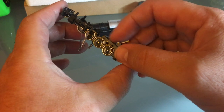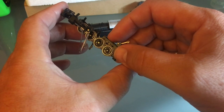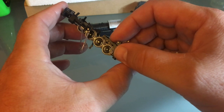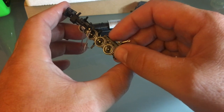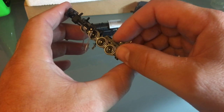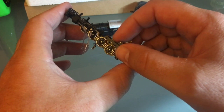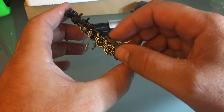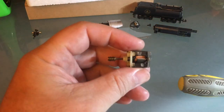What's going on with the gearing? For some reason right now, oh, there's something that binds. Now this, I wouldn't be surprised that it would have cracked gears. These are notorious for cracked gears. Sometimes it'll pass, but other times it'll block. See, now it's blocking. So let's just test the motor by itself. That's what I always do.